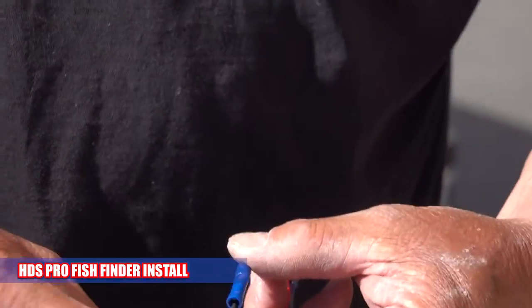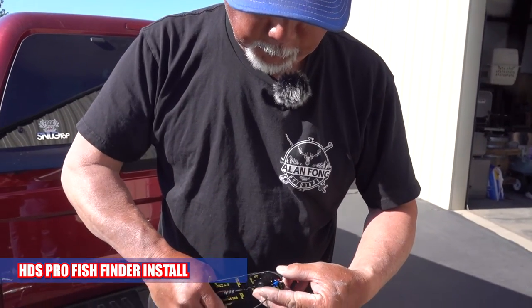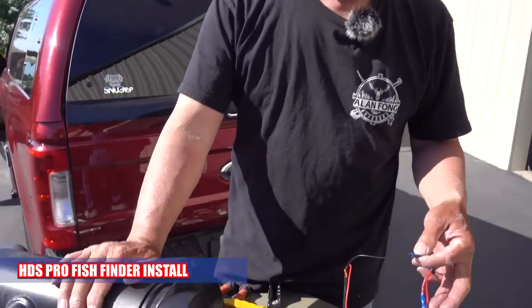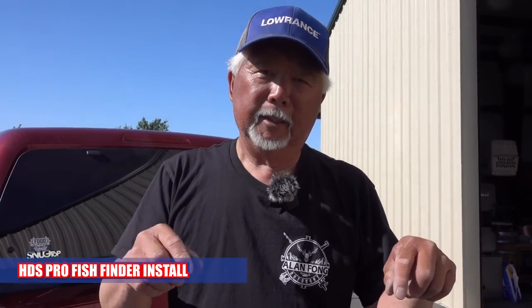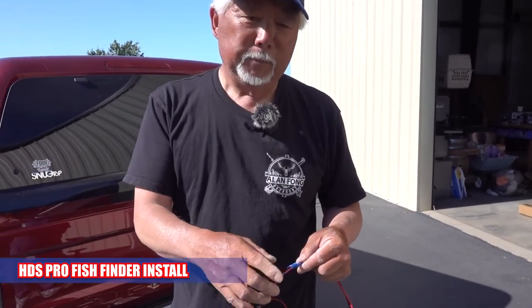So what I did on these is, he has a 24 volt trolling motor. So this motor is 24 volts. You have two of your trolling motor batteries and they're put in series. Basically you put them in series to get 24 volts. You can still tap off of each one for 12 volts. So that's what I'm doing, because I don't want to run all these powers.